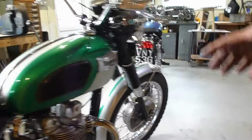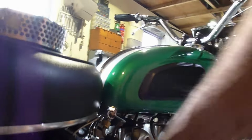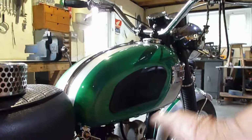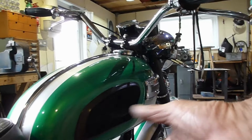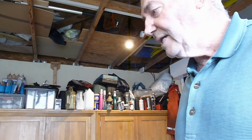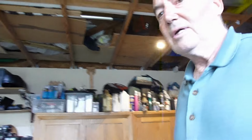And the normal thing with the slides is you pull them all the way back, make sure they go right to the top, and I've adjusted them with my finger to the top, just using my finger, making sure obviously the choke slides out of the way. But I'm just going to try another method, because I think that I'm slightly lifting on one more than the other.